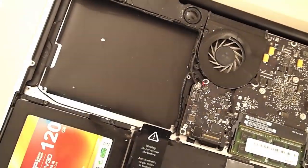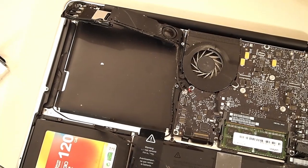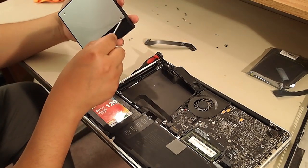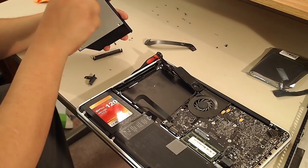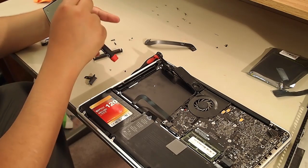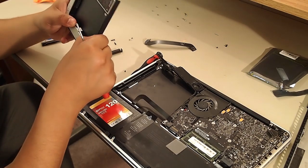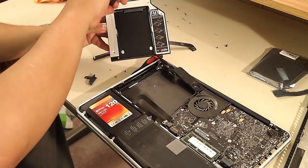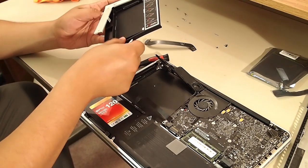And the CD-ROM will come right out. There it is — the CD-ROM DVD-ROM — you had to remove those screws to get at it. Now, this caddy is a bit universal, so the front part makes it a little too big for my MacBook. I have to remove it — it is removable, just remove all the screws from the bottom and you can take out that front piece. In your case it might fit as-is, but for mine it doesn't fit. So take out all the screws on the caddy — it's an extra step you probably won't need, but in case you have a caddy like mine, you can remove that front plastic part.